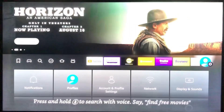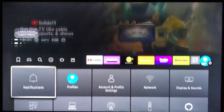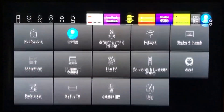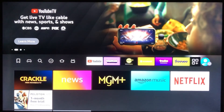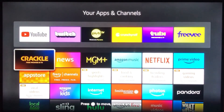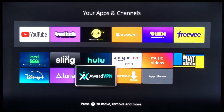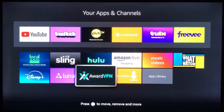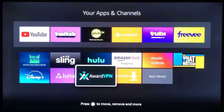For number nine, let's go back to the Fire Stick and check out some of the apps. Say your Fire Stick was acting normal, but you installed a third-party app and then it started acting up — you may need to remove that. Come over to the three squares with the plus to bring up your apps and channels, and remove the apps that could cause problems. Also look out for a VPN: it may not be set up correctly and may be causing issues, so you may need to remove it or contact the VPN's customer service. Delete any third-party apps you added that caused the problems.